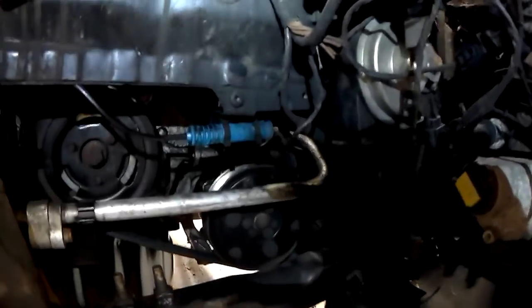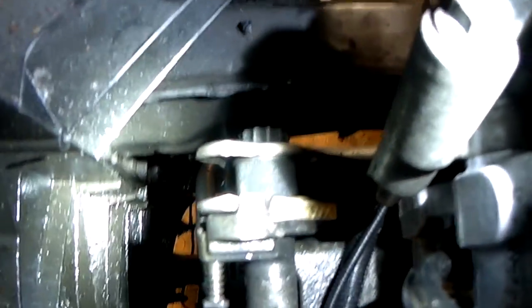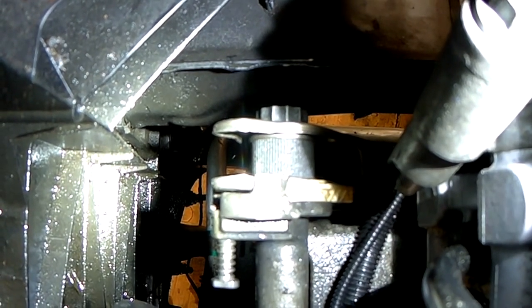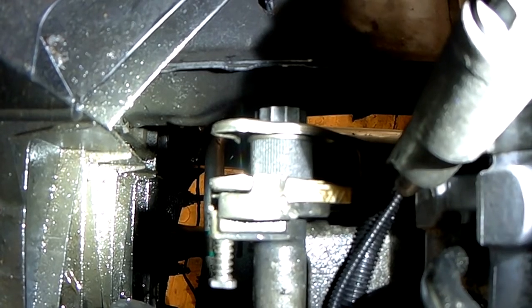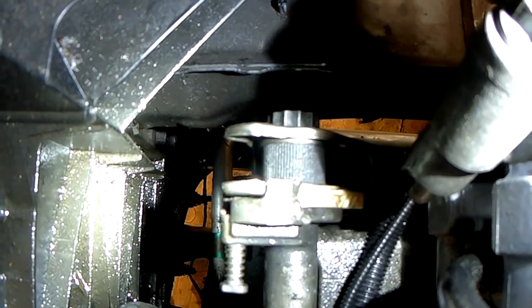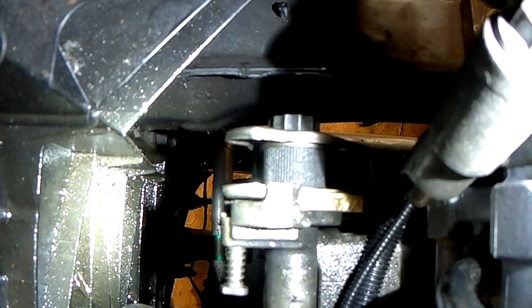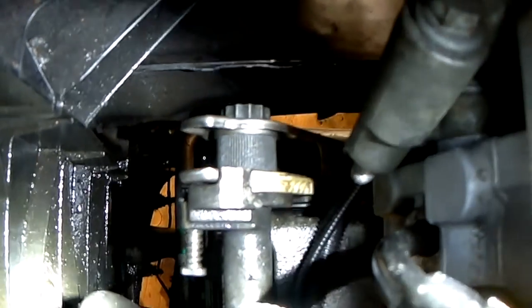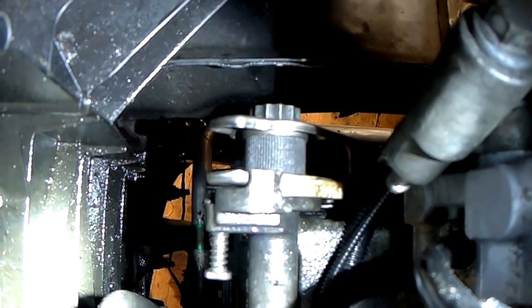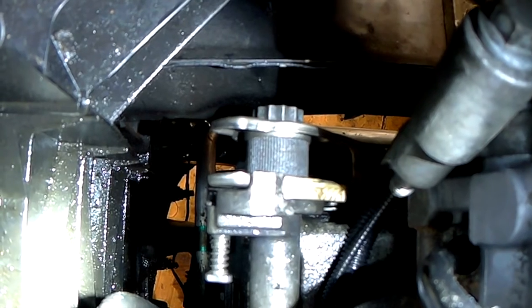Alright, let's see if we can slacken off the belt. So that spline in the middle of the picture there is a 21mm. You need to get a spanner on there, or the special tool, move it towards the front of the car from the top or from the back of the car from beneath, and that will release the tension off the tensioner, and you'll be able to remove the belt, and you lock it in position with that pin you can see there.